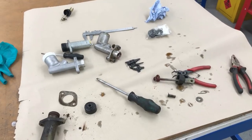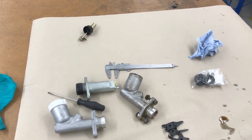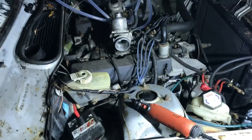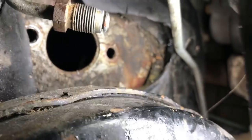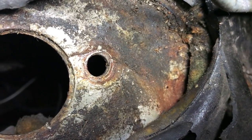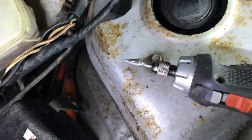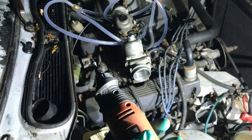I'll probably grab the welder and weld the bulkhead where it's fractured before putting it back together. Other than that, we're not far away from at least having the hydraulic side of the clutch working. I've peered into the clutch fork area and can't see anything abnormal, so it'll come down to whether the flywheel is rusted sufficiently to bond the friction plate to it - if it has, I'll have to pull the gearbox out again. I've just bolted the clutch slave back onto the bell housing. Looking at the area where the clutch master goes back, you can see the crack. From both sides of the bulkhead that looks like good metal - the front skin has the crack, but the back has a large reinforcing plate that's spot welded on and is fine.